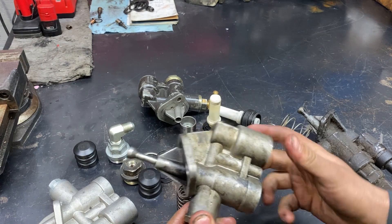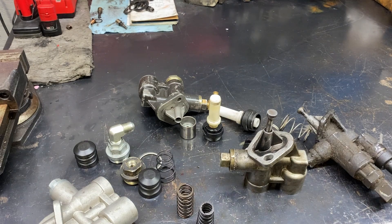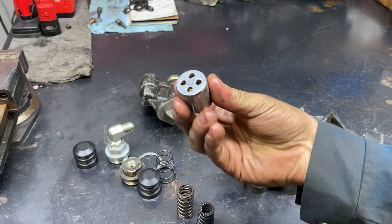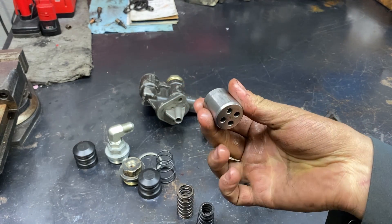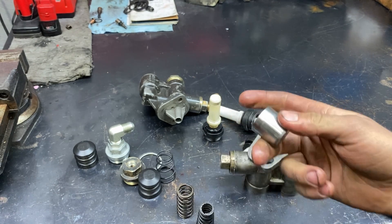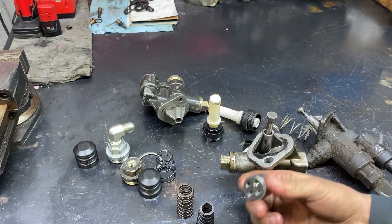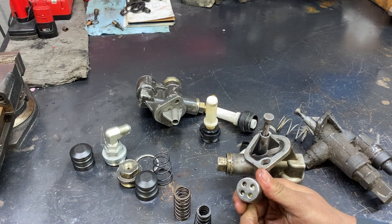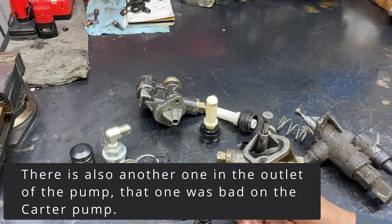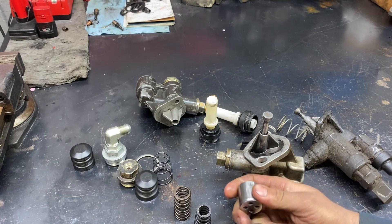Now let's talk about why they fail. I've got three pumps here and they've all failed in different ways. The first one — the plunger is letting air past the one-way valve, so it'll lose prime as the fuel system drains back into the return. You need these to seal well. If you have one that's failing and you really don't feel like changing it out, you can put a one-way valve inline with the fuel line going to the fuel pump. I think that'll work — I've heard of one person doing that.